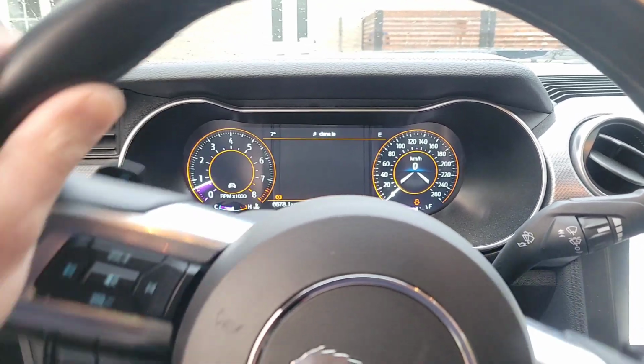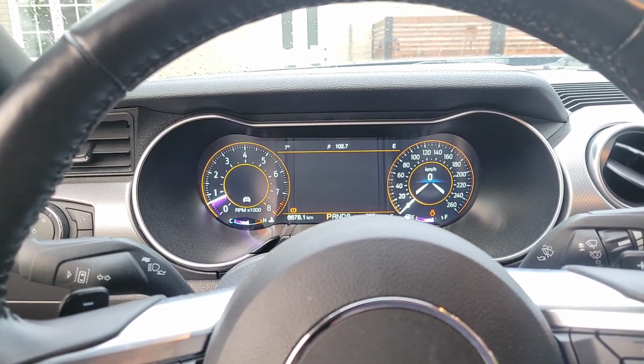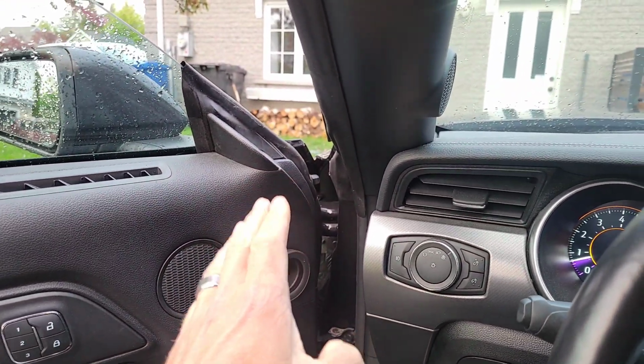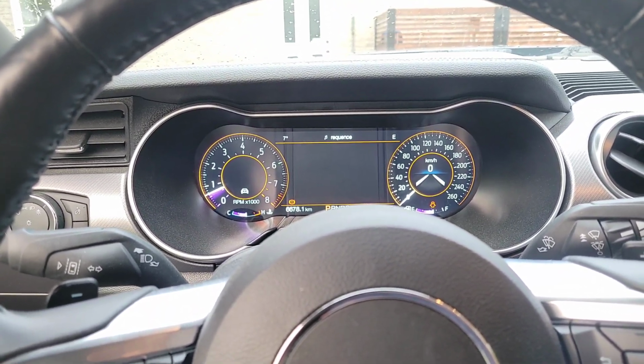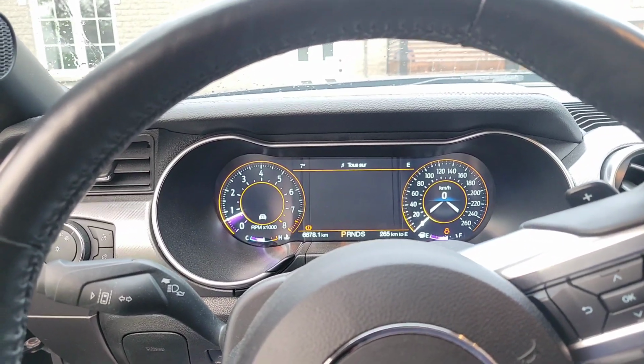Well, the big difference is how easy it is to turn the steering wheel, as well as the ratios between the steering wheel and the outside wheels up front. Now, those ratios are always adapting to your speed. So at lower speed, you turn the steering wheel less to go where you want to go.